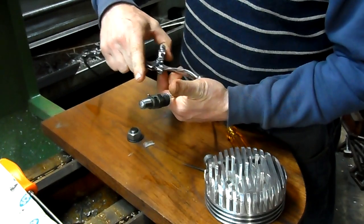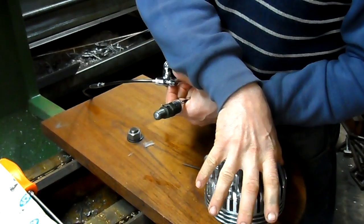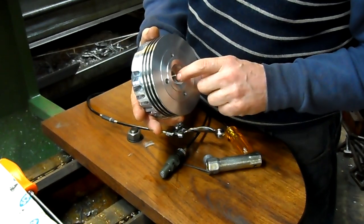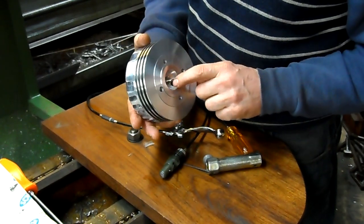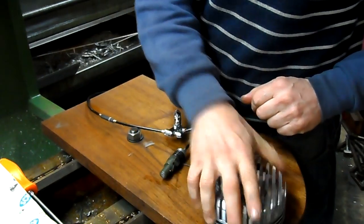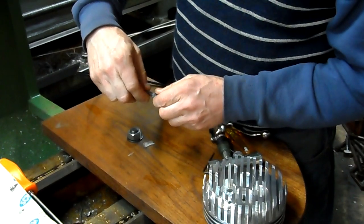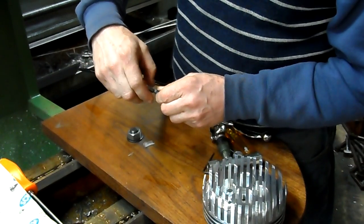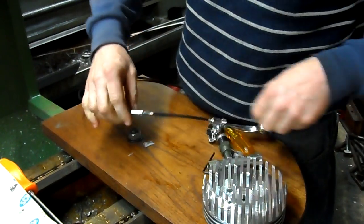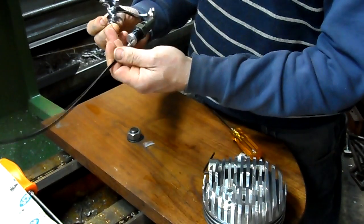And when it's adjusted like that, so the valve doesn't open too far, it also ensures that the valve poppet does not hit the piston. Because the compression release is installed on the angled hole, and the piston does come close. Now you can adjust this — you can turn it so that it tightens up the cable just a little bit. And that would be your complete adjustment.